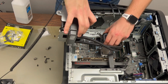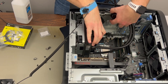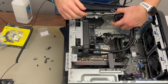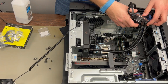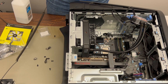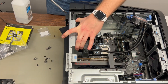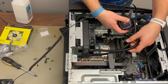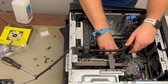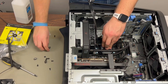We are finally ready to install the cooler. After a quick check to make sure the holes all line up on the pump head, line up the specialized Dell mounting bracket and slide it into place. Set the pump somewhere it won't fall or damage anything, and put that screw back in from earlier. I played around with the hoses for a while trying to get the pump to sit right, but it was just too close to the radiator — the tubes wouldn't sit correctly.